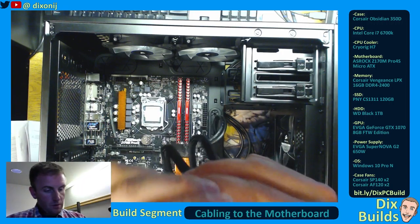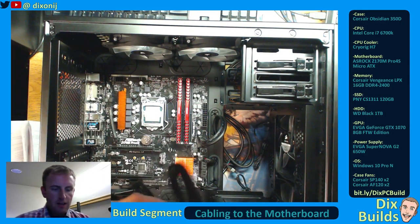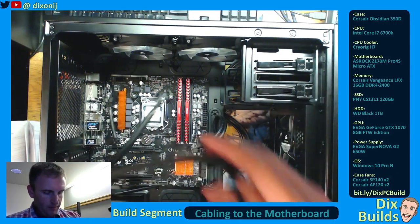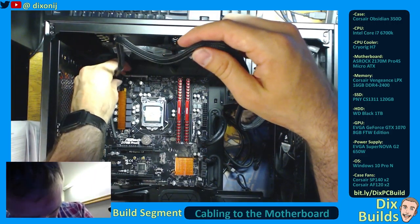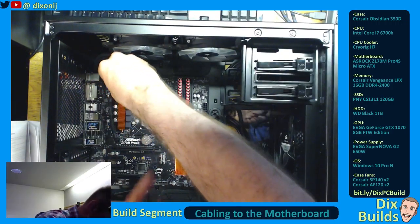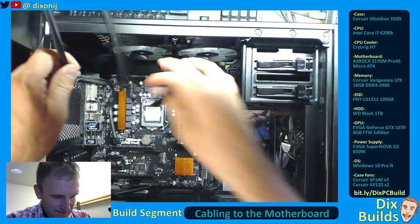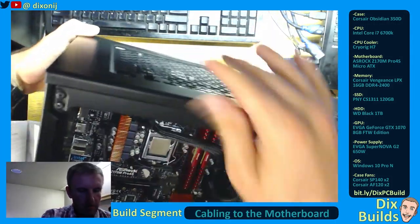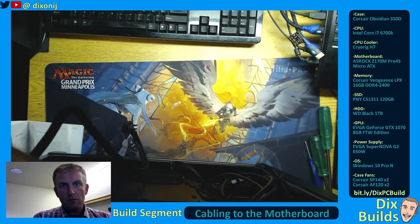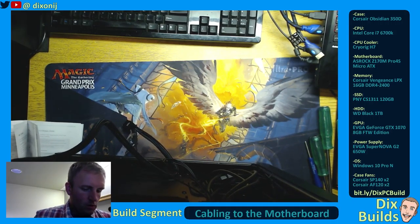I was just looking at this to make sure I was putting this in the right way. The reason I was checking is to make sure it wasn't wide enough, because there's a little tiny clip on the actual power supply itself. The clips are different widths — you have one width clip here and a two-width clip there, which means it will clip on in. That's clicked in, nice and neatly there. Thread this through the back because we don't want it to potentially hinder our access to this slot when installing our cooler.